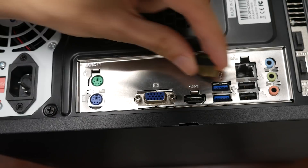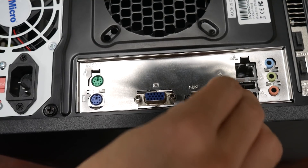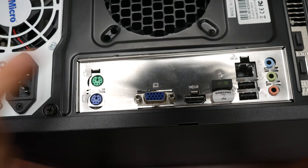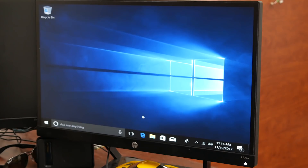I found the diagram for how to connect the motherboard headers to the PC case so I can use the power button and switches — following that and hooking up the cables accordingly. Now closing it up and screwing it in. For the back, installing the Wi-Fi USB adapter and our USB drive with Windows — no SSD needed, it runs the whole OS from that little USB. Changing boot order to USB and Windows starts right up, though it's a bit slower than an SSD.